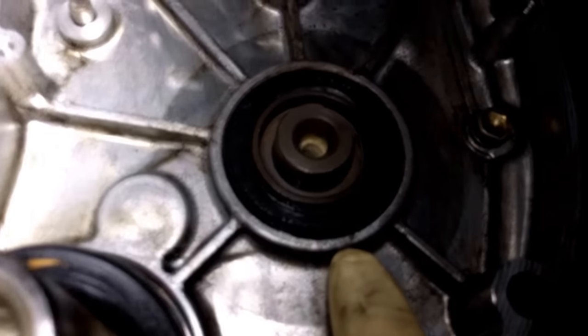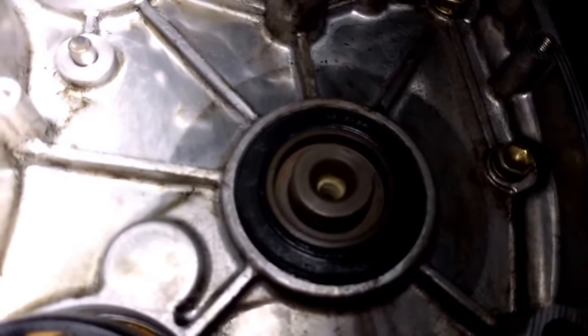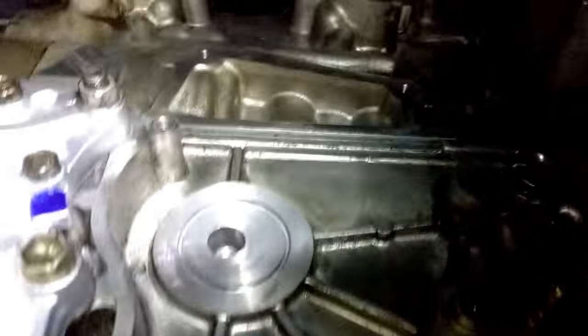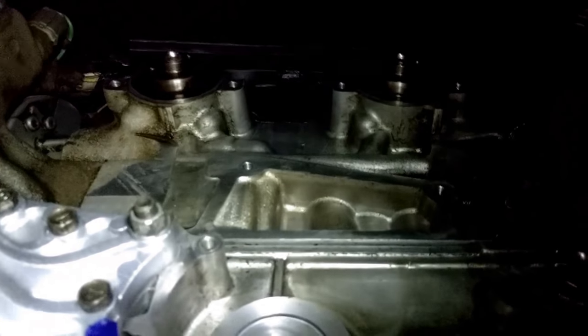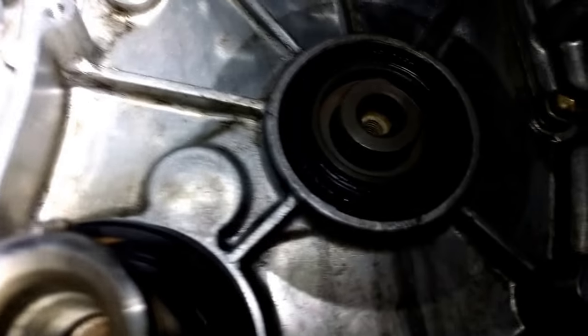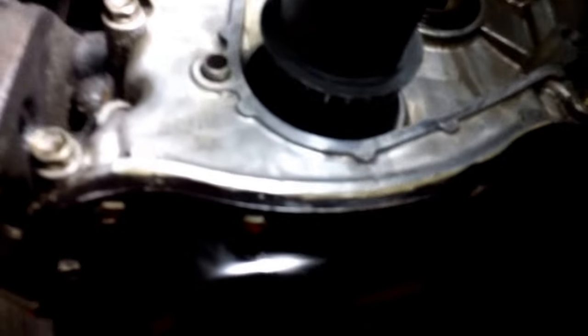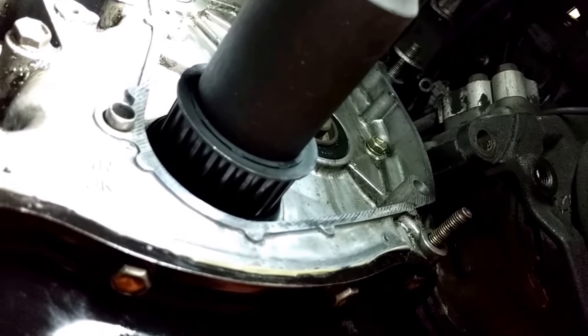This one's going to be tough to pull out — I'm probably going to have to pierce it and then yank it out with a pick. That's going to be pretty tough. And then way up top, which you can barely see, are the cam seals — same kind of deal there. I don't think I have to remove the cam caps; I'm going to try not to. But it'll be kind of pinched in there, so maybe a little tough to remove and tough to drive in straight.